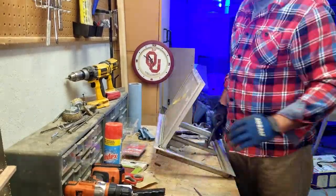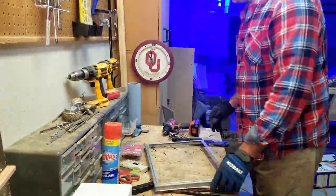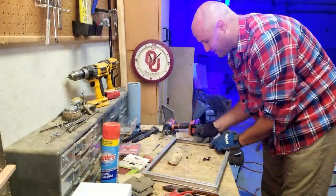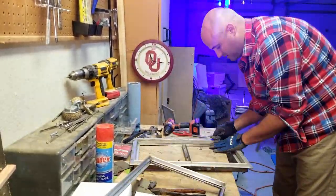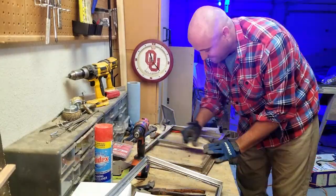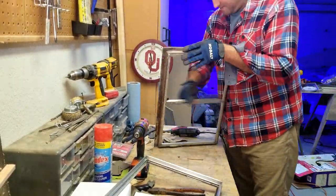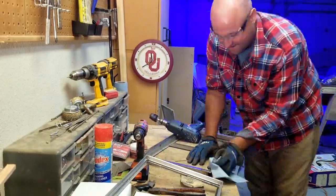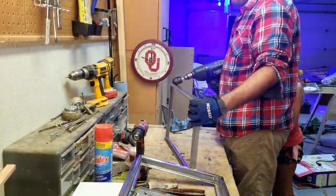I wanted to show start to finish how long it would take to do one of these windows. This window had the paint removed but that's as far as I'd gone. First, fully disassemble it down to all individual parts, then sand each part to remove the tarnished cloudy surface before polishing. It took about 45 minutes just hand sanding to get it fully prepped, so each window takes about an hour. In total, I probably spent about 15 hours to do all eight windows in my trailer — so it's quite a bit of time, but definitely worth it.